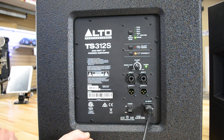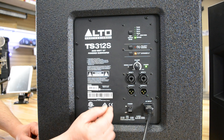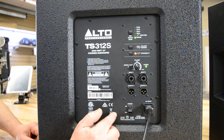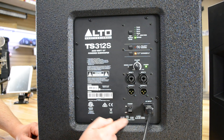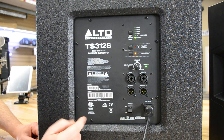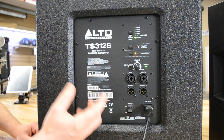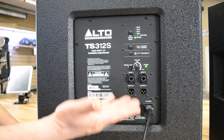Power switch. Alto subwoofers always come pre-set up for the country of origin they're being shipped to — in this case, pre-done for 110 to 120. Internally there is a jumper that can be chosen for 220, but if you're buying it in Europe it's all set for you. Power consumption is written right at the bottom: 1,000 watts. Also serial number and safety certification for the amp plate — that tells you quality and responsibility has been checked by a third-party company. That's the amp plate — no fan, everything is Class-D power-amped, all cooled internally. They do have a basket covering all the amplifier and sensitive electronics to keep them safe.